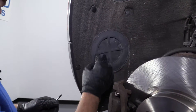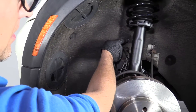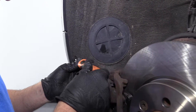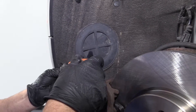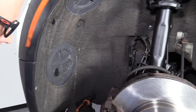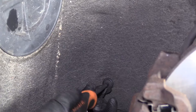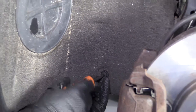We're going to take these push pins out. Some of these are Phillips head push pins — you take the center out and then you can pull the rest of the pin out. I'm just going to use a Phillips head screwdriver. Loosen up gently on the push pin, and once it's about half an inch out, then you can grab it and pull it out. Sometimes you have to hold the base, and sometimes they won't come up. Do it gentle enough and they will come up.